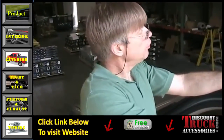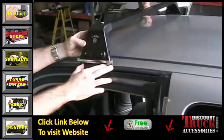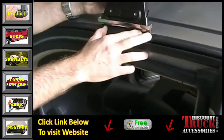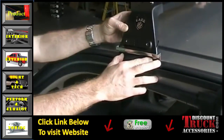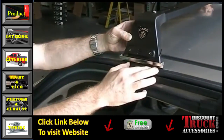Take the whole entire light assembly and place it into your rain gutters. Make sure that the end castings are up against the back of those rain gutters — that will be your final position. Once you find that, take your half-inch wrench and the Allen wrench provided in your hardware pack and tighten down those top two bolts to get it secure.